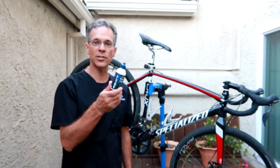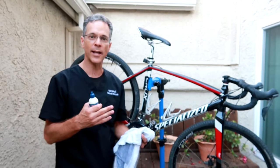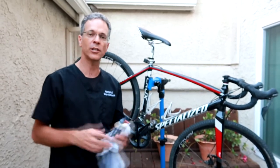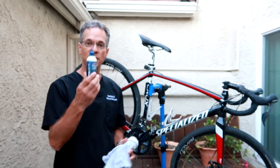If you're using the Squirt Wax Lube, one of the most common questions is: in between rides, how often and what do you do to clean the chain? Secondly, how often should you reapply it? Because I'm in dry conditions, I reapply it about every hundred-ish miles.